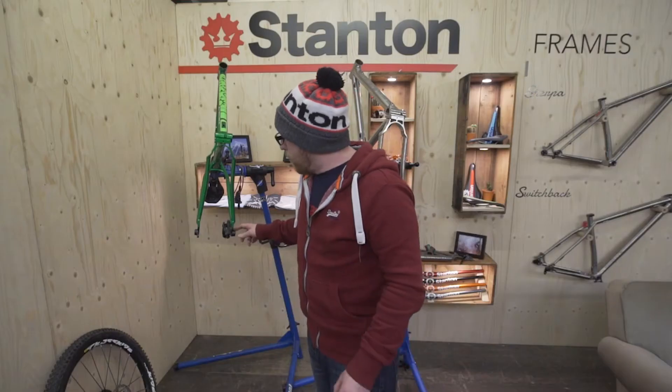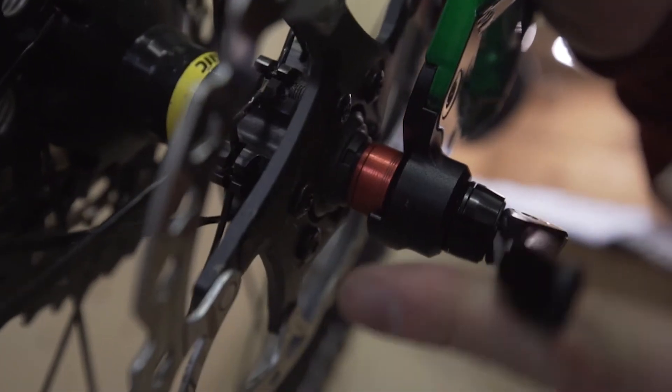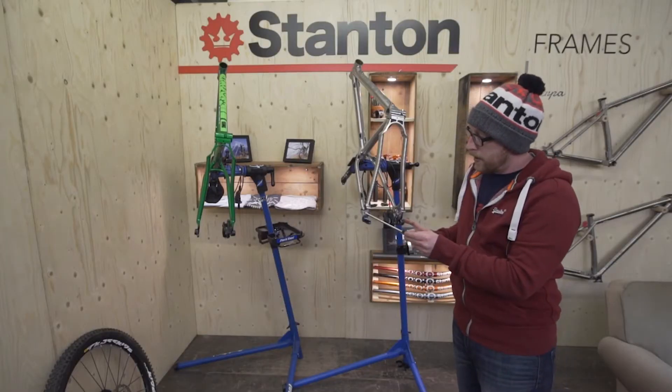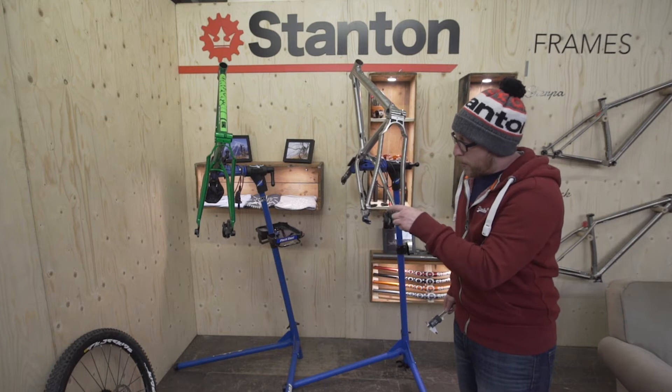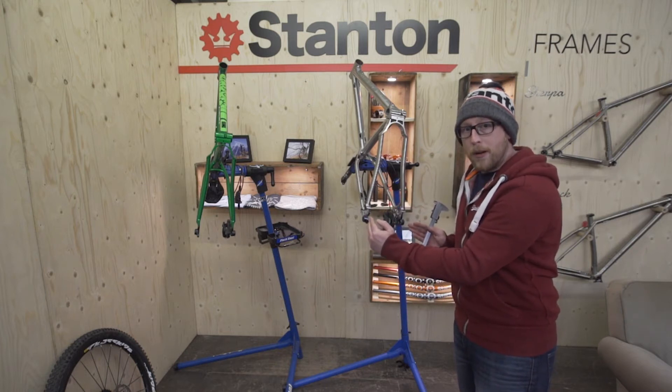You can see the brake works absolutely fine. With the 12x142 dropout, the frame is pulling in 1.5mm either side. On a boost dropout the frame is obviously still made to the same width, but with these little chamfers the boost hub pushes in and spreads the stays open 1.5mm either side.